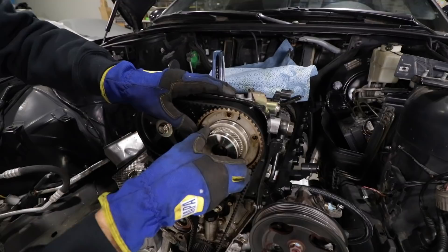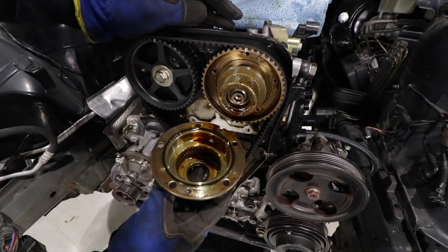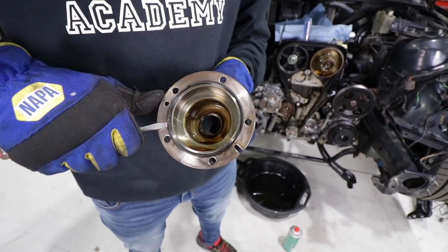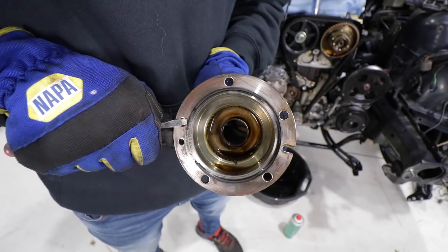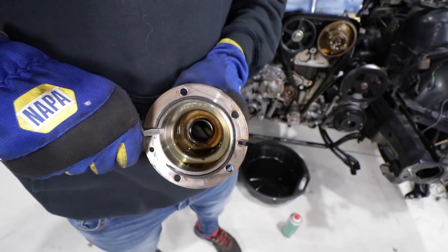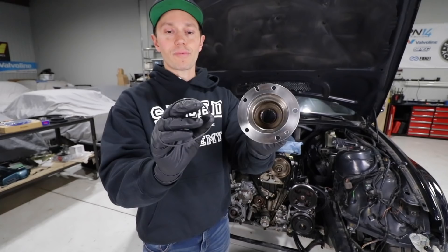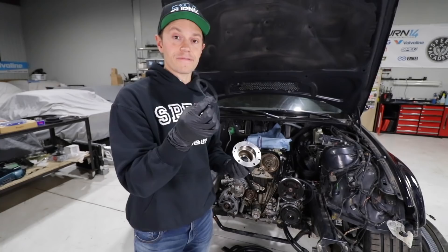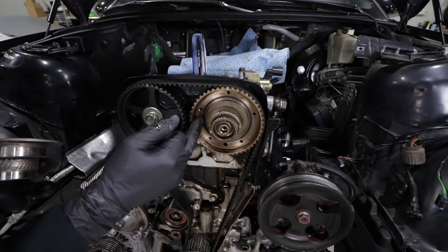There it is. This is the likely reason why this rubber seal was leaking — it's not rubber anymore. You can see it's like a hard plastic just coming off. So I'm going to get this done and show you what we have for a new one. I've gone ahead and cleaned up the mating surface. That old gasket was so rock hard I had to use a little scotch brite on there so the surface is nice and clean. And this is what a proper seal is supposed to look like — stretchy and soft. I sourced this off of eBay; I'll make sure to provide the link in the description. They're pretty cheap and they came quick. I've already put one on there. I believe they are Viton.